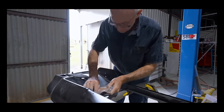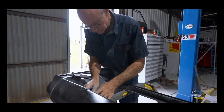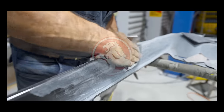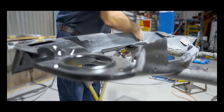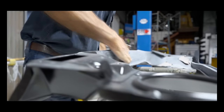This is part 47 of the Holden GTR XU1 restoration. In this episode, we're going to be preparing panels ready for reassembly on the Holden Torana. What I'm doing today is preparing these panels. I'm knocking them all back with 400, so they're ready to go on. This will be the final rub on these panels before they're reassembled onto the car.